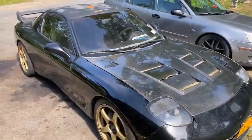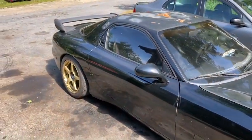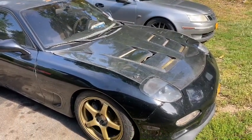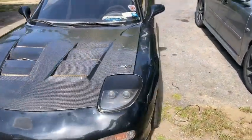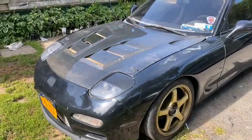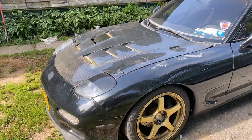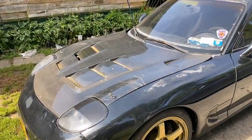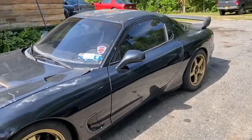It lives! The laptop shows one step down. Got the TPS error fixed. Now we're getting a crank position sensor error any time we start to get a heavy load on it. I'm going to reground the coils, move the crank position wiring away, then take it for a ride and see if we fixed it. The TPS error being fixed has made it a lot nicer to drive — you can actually cruise and the throttle isn't loading up and popping and banging like it wanted to.